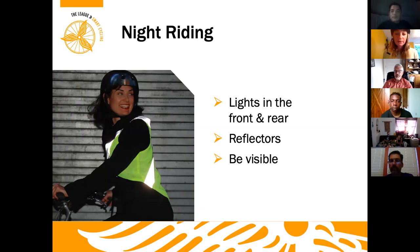A lot of times people like to ride with an extra tube. Like we said earlier, not only is the PSI labeled on the tire of your bike, the size of the tire is also labeled on the tire. Similarly, the tube is labeled with its size. So know what size tube and tire you have, and that way you can go into a bike shop and say, I need a tube that's 26 by 1 3/8. And that way you know the tube size that you need to replace with.